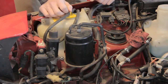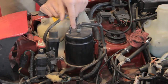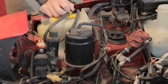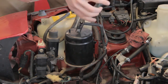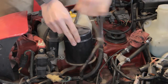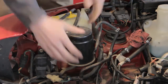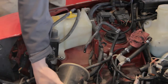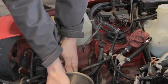There are two connectors on top and one on the bottom. This hose right here, all you've got to do is just kind of pull it right off — this goes to a connector over here. Next, you've just got to take your pliers and take out this one, and this one should pop right off as well. Now I only have one more to go. What you want to do for this one is take it out of its holder, kind of flip it upside down. You can see the hose underneath there, and then you should be able to just pull it off too.